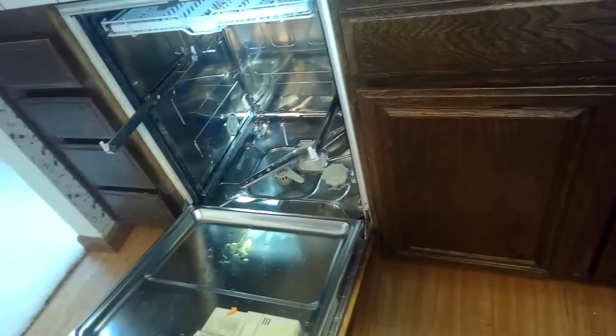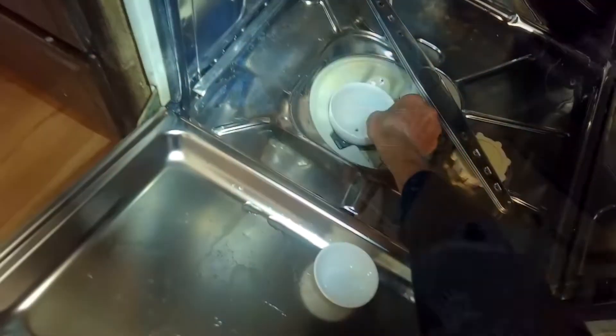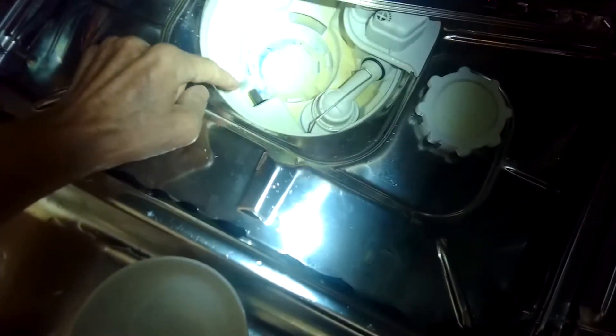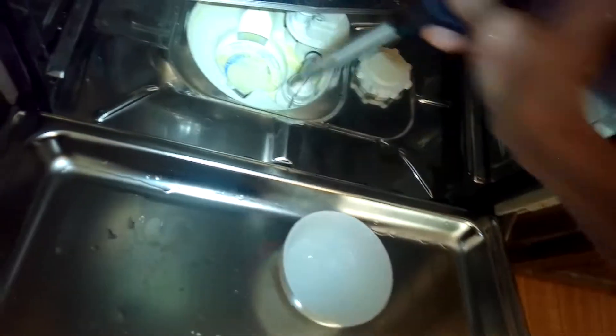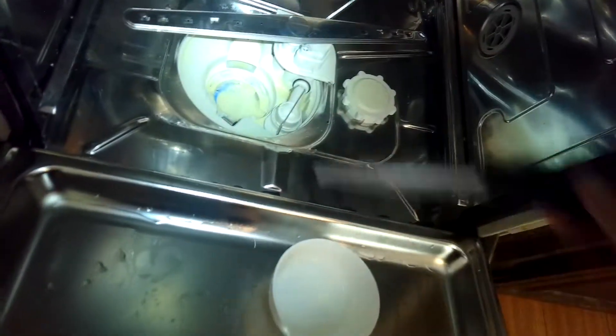With the racks out, pull the filter. We'll use a bailing technique to get the water out — just use a small bowl to get most of it, then a turkey baster near the end. Just so you know, this is a temperature probe — make sure you don't push it in, because a lot of people think it might be a button. If you push it in it'll create a leak. It's normal for water to be in the sump at the end of the cycle — called a wet sump — Miele and Bosch both do that. Before a repair, get out as much water as you can.